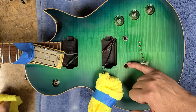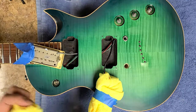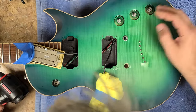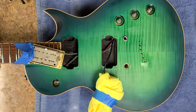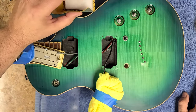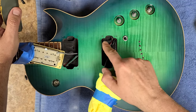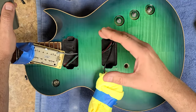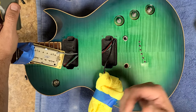I fixed some damage over here and after sanding it out and hitting it with air, I don't see any deep scratches anymore. The body seems to be pretty good as far as being straight. The next thing is sanding down with 2000 grit — I've already got some soaking in water. One thing you have to be careful with when using a flexible sanding block is all your edges and corners, because the pad will wear those corners down really really fast if you're applying pressure. I don't use a lot of pressure — I let the sandpaper do the work.